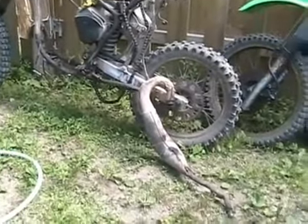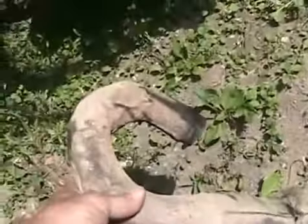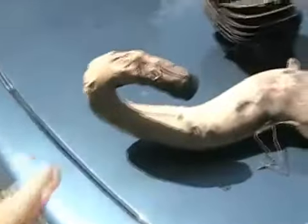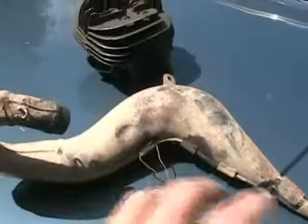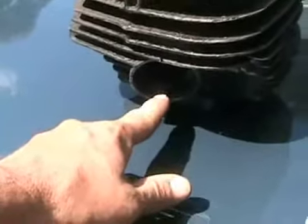How back pressure works — I'll start with a two-stroke engine system. They're pretty simple, but back pressure is 100% important to make a two-stroke work properly. This intestinal-looking thing is called an expansion chamber — it's not a muffler, it's not an exhaust pipe. It has a particular reason why it's that shape: to allow the hot gases that come out of the exhaust to expand, and to collect a shock wave and send the pressure wave back up through the exhaust.